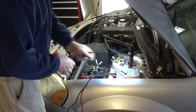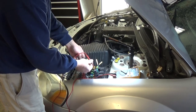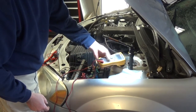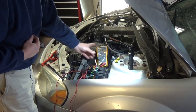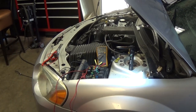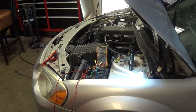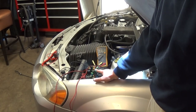In order to get power to the high side, this relay has to close as well. When this relay closes, it's going to switch and close, and we're going to go to this wire. The low side actually goes to ground, so this relay has to close as well to give power through to the high speed relay. Then it goes to the 40A fuse. I'm going to put the adapter on this relay on high speed. I have my voltmeter across the red and black — that's my control side — looking for 12 volts when I turn the switch on. I'll turn the switch to on position and we should have 12 volts.